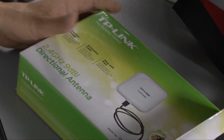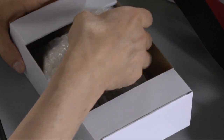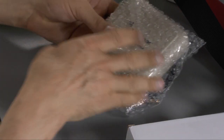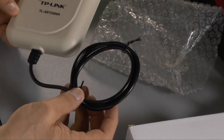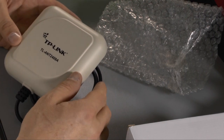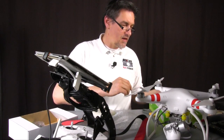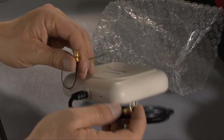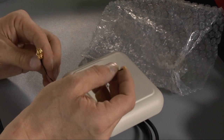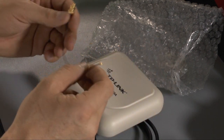It's easy to install and it doesn't need extra power. That's a Wi-Fi antenna like this one you can put onto the range extender. I will show you how this one looks like. So that's the antenna here — you see TP-Link. Here is the line you have to connect to the range extender, and you have to have an adapter because you have to connect the end of the antenna here with the small connector on the electronics of the range extender.